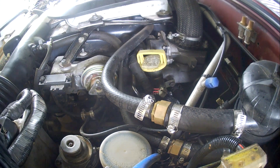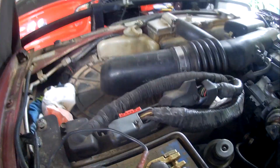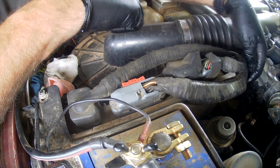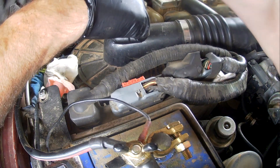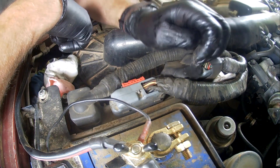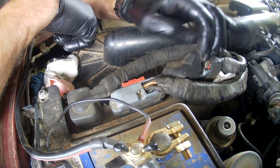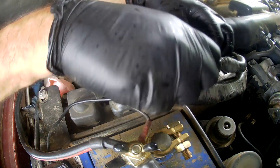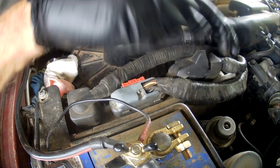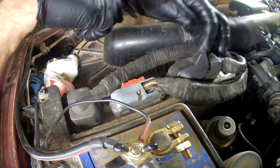One of the issues that can happen is if it's really bad, the oil ingress can get through to your ECU, because these cables are also attached. If you follow that rear cable, you'll find it comes out of one of these connectors. If you take these out, you'll see if there's any oil in there — give it a clean out with contact cleaner. Just be careful what you're doing, because if there's anything in there it will disturb the signals. Mine is like everybody else's — you see this here, this was done on a Holden mod where they cut the waterproof boot just to get into the cables, and then just left it. So mine's as bad as everybody else's that's had that mod done.